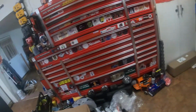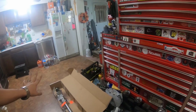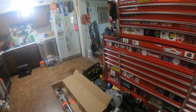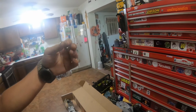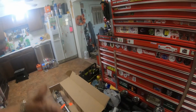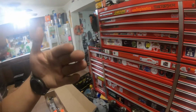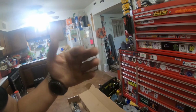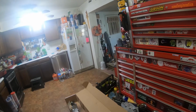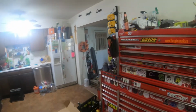So that rack obviously had some kind of problem. I think it was some kind of problem with the threads, because even though the high pressure line threaded in fine, it looked like it went in crooked, which is telling me that either they remanned it and when they tapped the threads crooked, it caused its own leak. That's the only thing I can come up with, because the line looks fine.